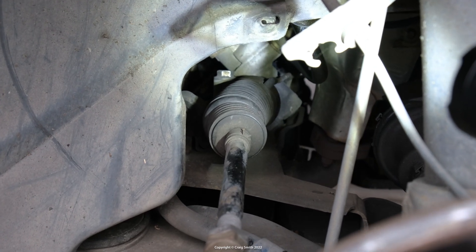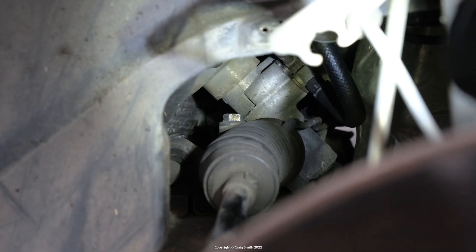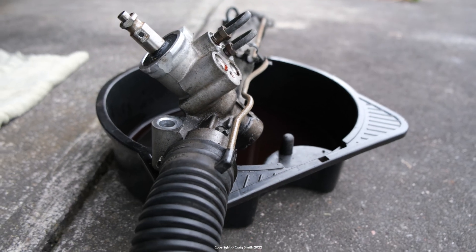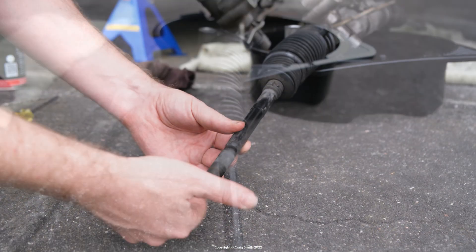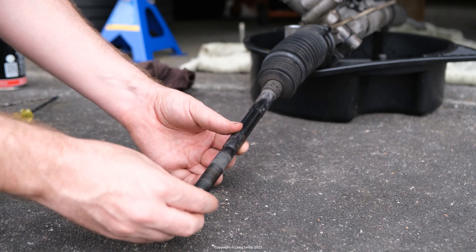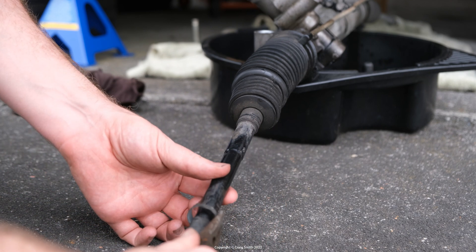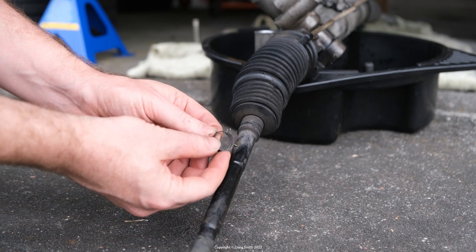Now to look at the inner ball joint. If you're working on the car, this is the restricted view you've got, working in that space to get the boot off and get tools in. In my case I was taking the whole rack out, so this is my view instead. The locking nut needs to come off because the boot needs to be slid off — put it somewhere safe and keep left and right tracked. The boot is held in place with clamps; the smaller one is usually a spring type actioned with long-nose pliers or vice grips.